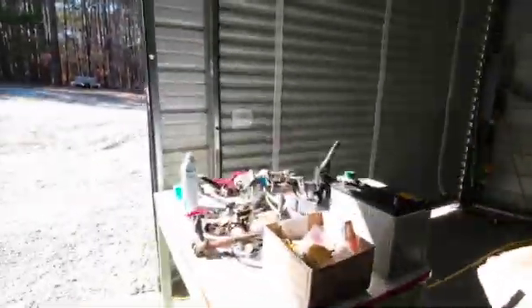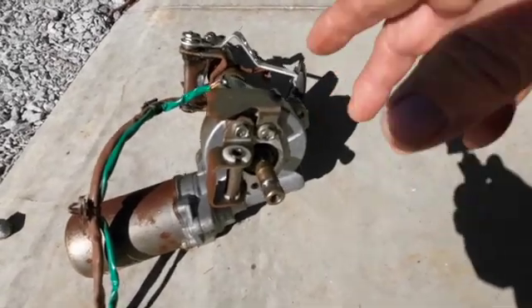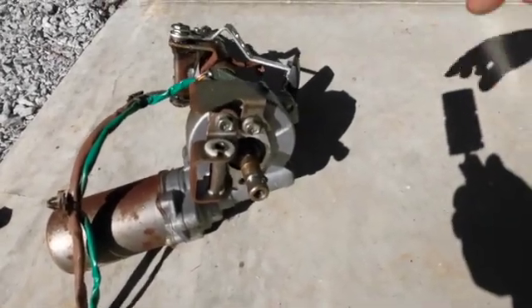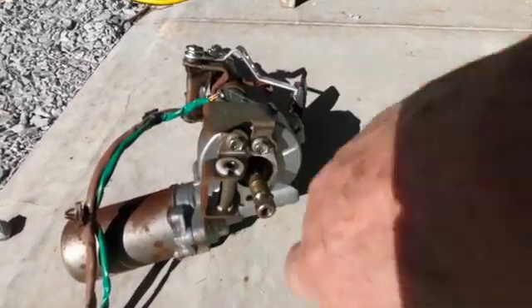One thing I found out — and I'm going to put this out there to save you from doing it. This end goes toward the steering box; that end goes toward the steering wheel. I'm pretty sure that's a collapsible shaft, which is why it has that grooved shaft that slides over the other shaft. When I took these bolts out and put them back in, the bolts will actually touch part of the mechanism inside and lock the whole thing up. I thought I had broken it, because I had to tap it into place with a hammer. I took it all back out, studied it, and realized that was my problem. So just make sure you don't do that — these bolts don't need to go any further in than they are, or they'll touch a big wheel that's supposed to turn inside and lock the whole thing up.